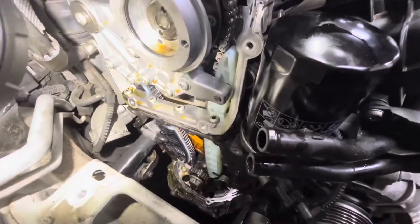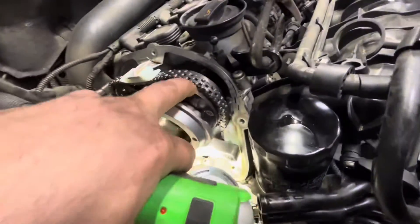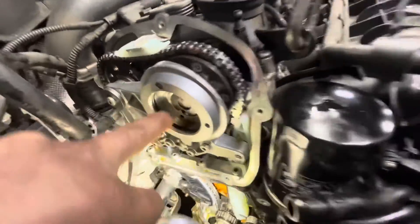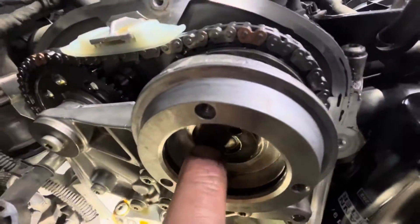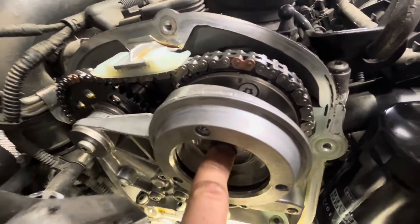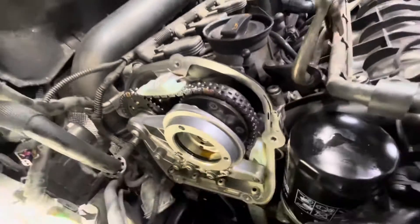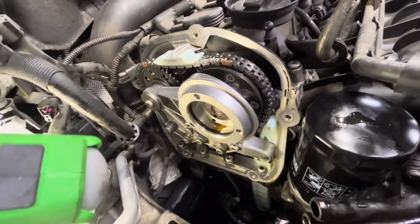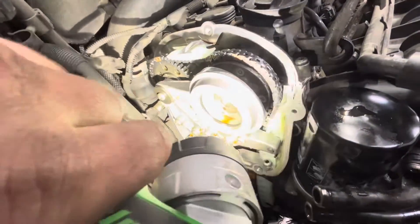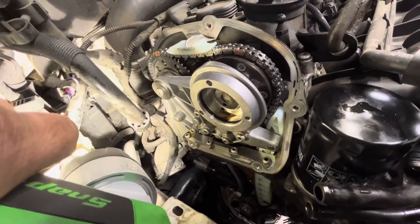The only variable here is the adjuster that's built onto the end. If that starts to act up, or if there's a problem with the adjuster magnet or this little bolt here that goes in — the adjuster magnet acts on this and that's actually what moves the oil through it and moves the chain back and forth. The car won't know the difference. On these it's a pretty solid bet it's going to be a chain issue, but every once in a while you'll see a cam magnet fail, or on the newer ones the actual camshaft itself fails.